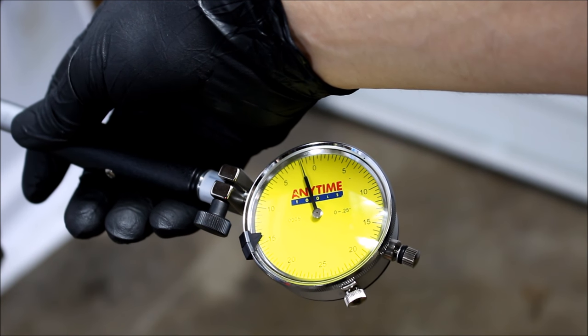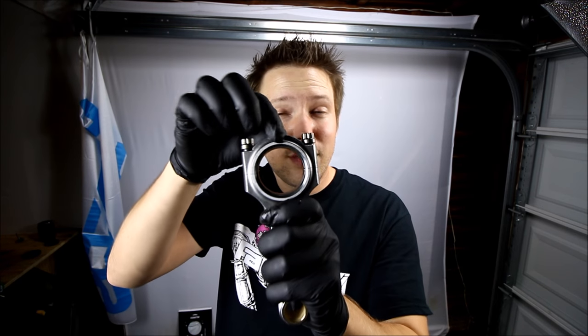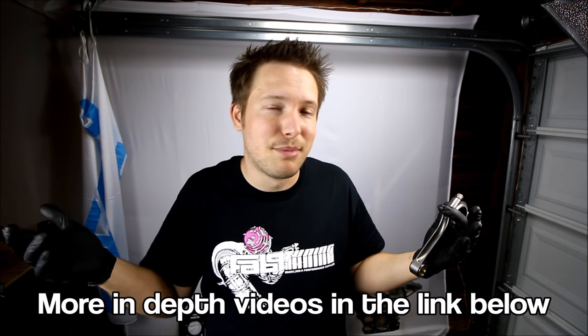That is 18 ten-thousandths, and I want my crank journal to be between 18 and 20 ten-thousandths. For the rod bearing clearances it's the same thing — you measure the crankshaft where the rod is going to bolt up to, then use the bore gauge to measure the bearing with the cap torqued down. The difference between those two is your oil clearance. For the rods, I wanted 20 to 22 ten-thousandths. If you are interested in all the clearances I've chosen for my engine, that will also be in the link below. That was a very brief overview of how to measure your bearings — just google how to read micrometers and how to measure bearing clearances.